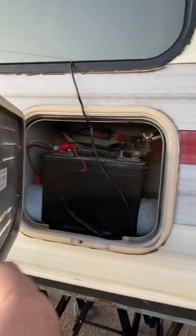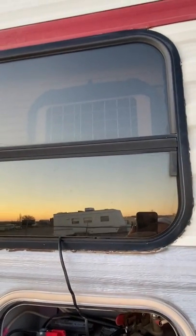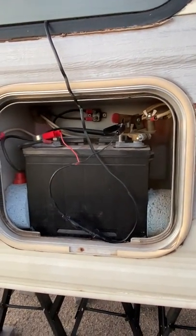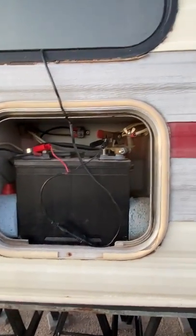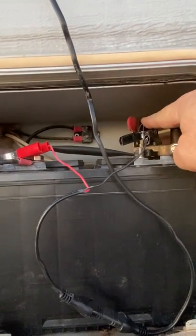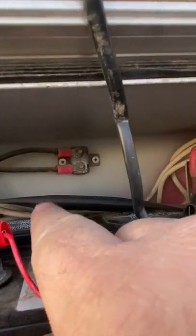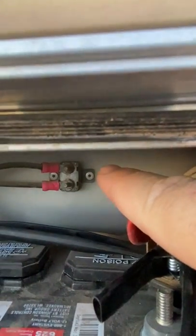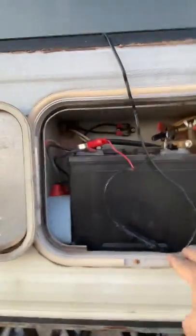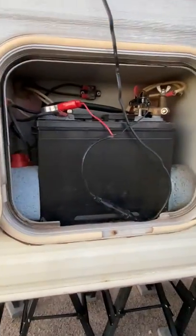The next opening here is your battery box — one battery. Modern campers will have two or more. I've got a solar panel facing south in the window, hooked into my battery to keep it topped off while I'm away. I store this here on Kirtland Air Force Base in Albuquerque. This is the battery disconnect on/off. Something I didn't know when I first got this camper — right back in there is a little circuit breaker. I thought I'd bought a lemon. There's a little tab on the side next to that rivet; once you push that in, boom — I had power. Something weird about this one: the negative is the white wire and the positive is the black.